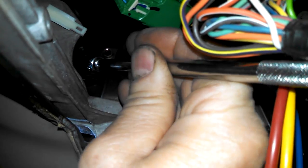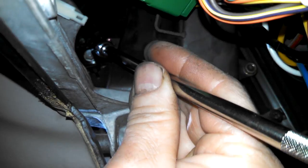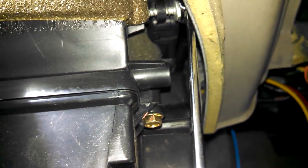We can just get her down here. Let's use our swivel and extension and put that screw in. And we'll have two more to go. Here's a shot of my 8mm wrench I'm using on the bolt in the front. And probably if you use maybe a gear wrench, a ratchet wrench, it'll go even a little faster, but there's the access for the bolt in the front.